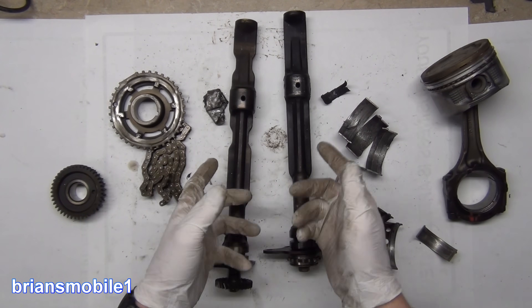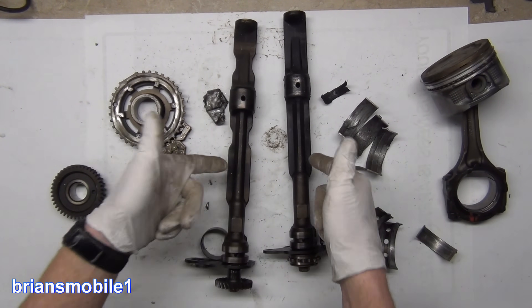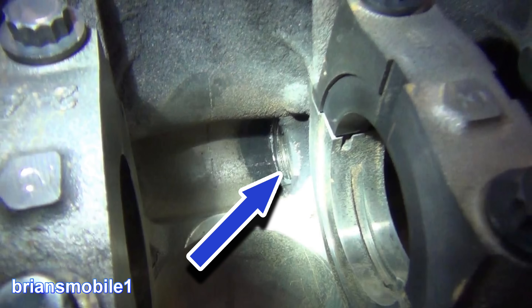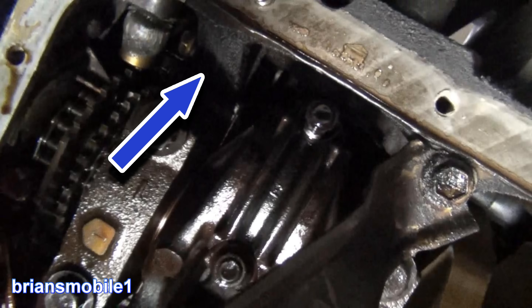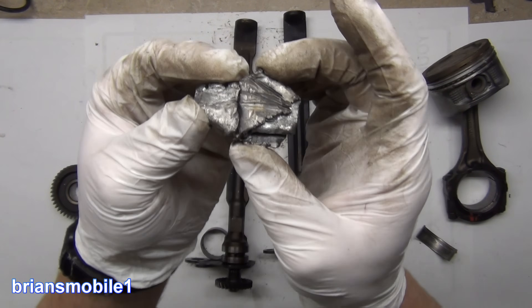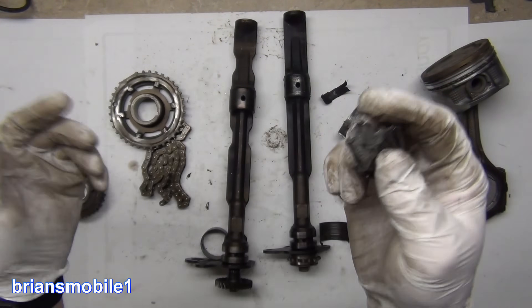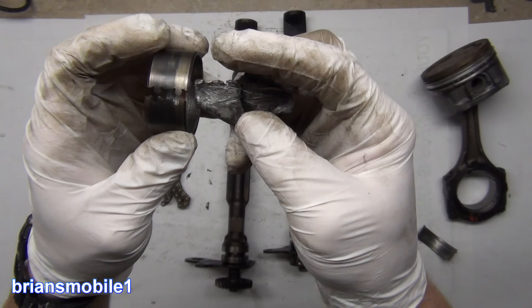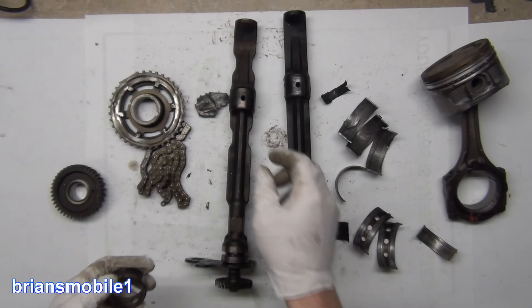These are not supported at the end of the engine block. When you look at the engine block, the same black color is found throughout. You can see where the engine block got really hot — this is ground zero where the balance shaft bearings died. You can see the normal virgin color of the engine block — contrast that with how it looked before the block was cleaned. Ultimately this piece got munched up by the piston from number three and got ejected. You can see that these match — the female end here and the male end there — and beyond that it's been smashed beyond recognition.